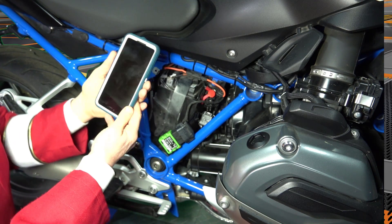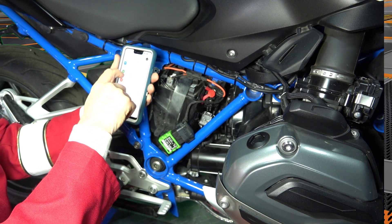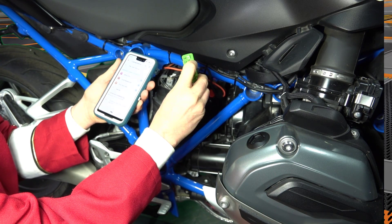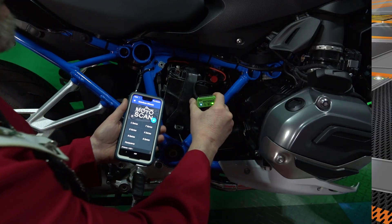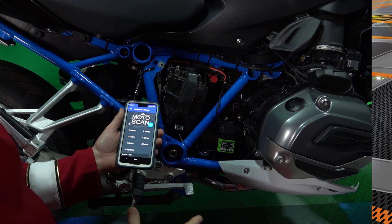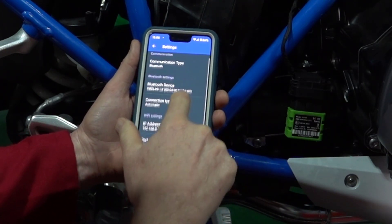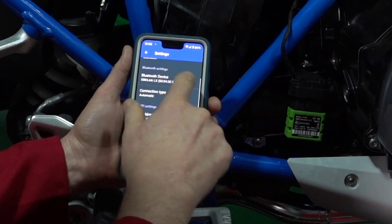We're going to take our phone and go to our settings — this is an Android. I'm going to go to my settings and go to my Bluetooth. I would put 'pair new device' and then push this button on the little corner. You push it and basically it's going to go into discovery mode. Once I've got this connected and it's Bluetooth to my phone, I then turn on my motorcycle — I just put the power on. I don't have to start it at this point. Then I go to my settings and my communication showing me that I'm connected to my Bluetooth, and I get my OBD — so I should be connected to my OBD-Link.